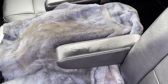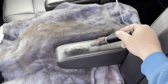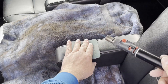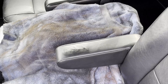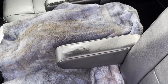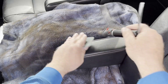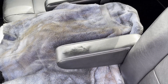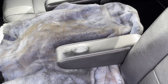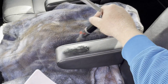I'm going to let that flash off a little bit and come back. This dried up enough — I'm going to smooth it out just a little bit more. We'll put one or two more coats on there, try to blend that out just a little bit better. Sometimes going in different directions when you lay down your product helps smooth out those gaps in between the wrinkles.